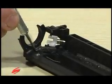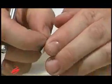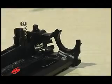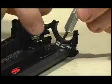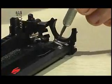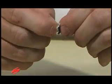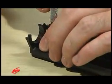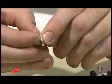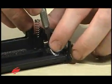Remove the release liner from the wiper blade end foam. Press against the foam to activate the adhesive. Remove the release liner from the appropriate wiper blade end felt and install into the waste bin. Press against the felt to activate the adhesive.